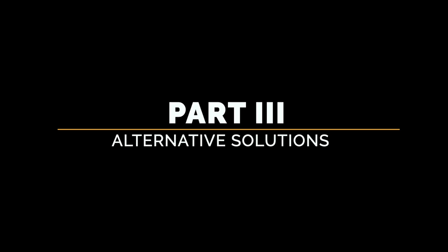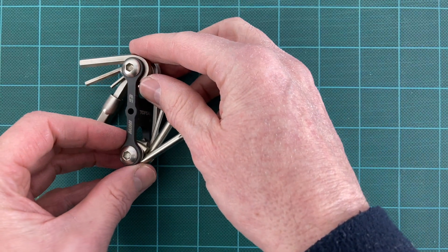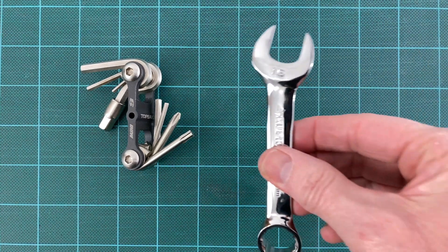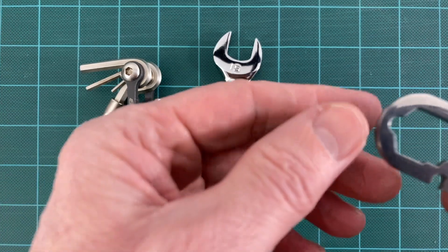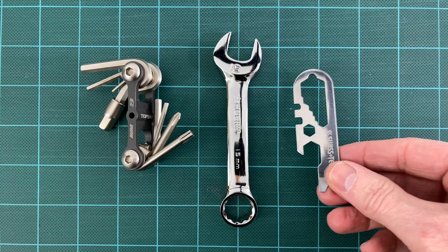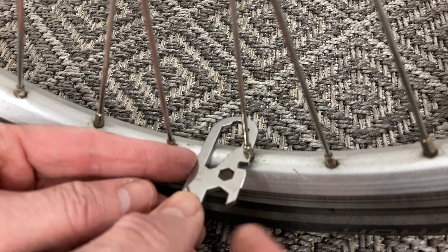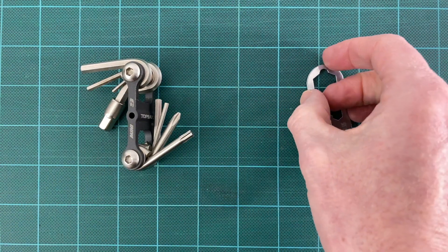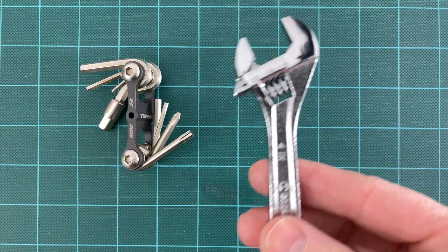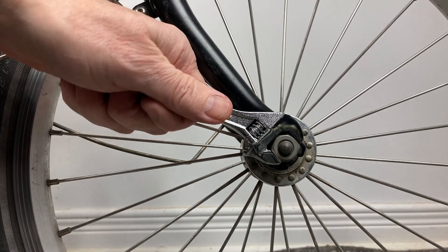There are other options as well. Of particular interest, if you're on a tight budget and you already own a conventional compact bicycle multi-tool such as the Topeak 9 Mini, bring the multi-tool along and supplement it with a stubby 15 mm wrench, available for a few dollars at a local hardware store or online. To complete your emergency kit, add some tire levers and possibly a small key holder like the Swiss Tech 14-in-1 multi-tool for the rare cases when you need to tighten those 8 and 10 mm nuts — it also incorporates spoke wrenches. A small 4-inch or 10 cm adjustable wrench could possibly replace the 15 mm wrench and the small key holder, but it would be at the limits of its capability with the 15 mm axle nuts and should probably be used in emergency situations only.